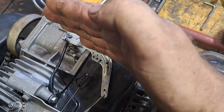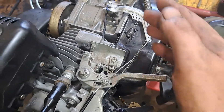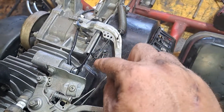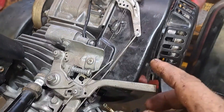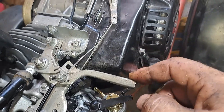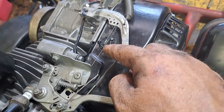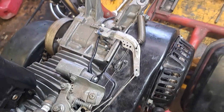When this pulls, this is the part that actually controls the governor. The higher the RPMs go, the more it wants to idle down — it'll pull back on the spring and the spring will give. But if there is no give on it, by putting a few little tiny zip ties on there, it'll be full throttle all the time. At wide open throttle this would normally pull back on the arm and the spring would let it go, but we got rid of that.